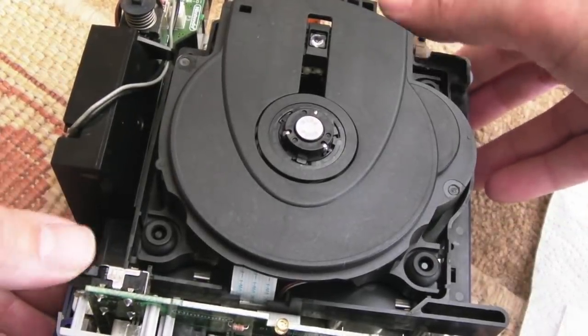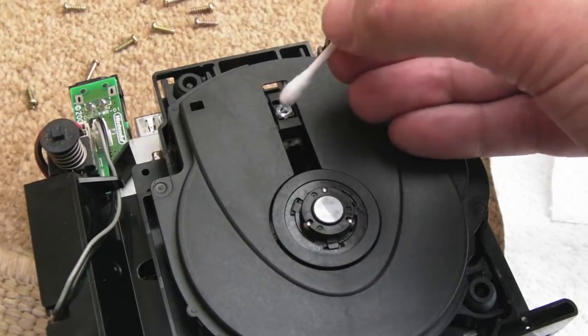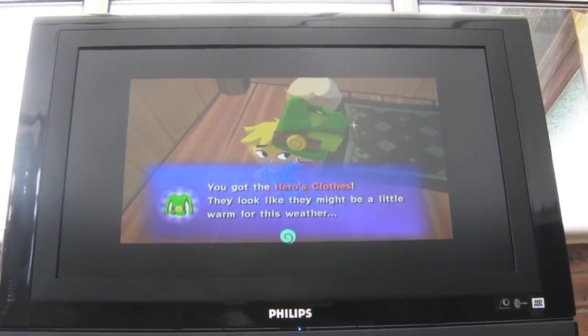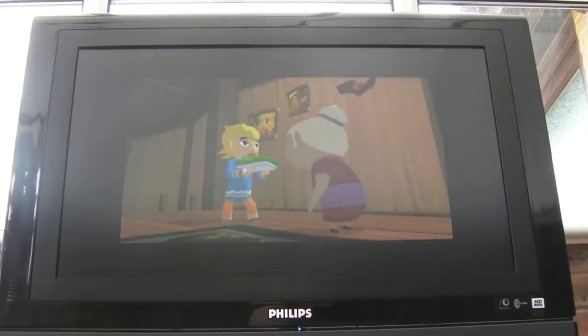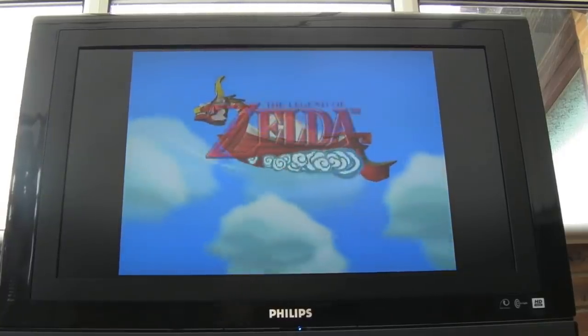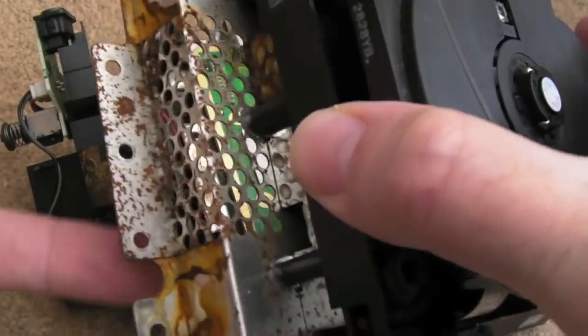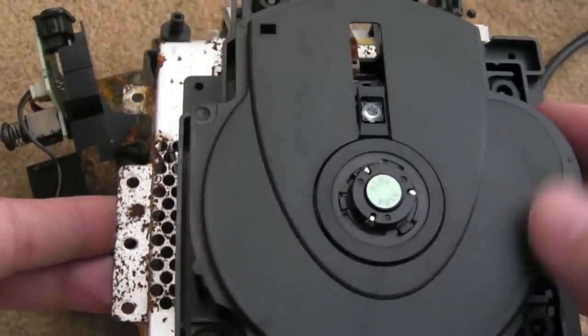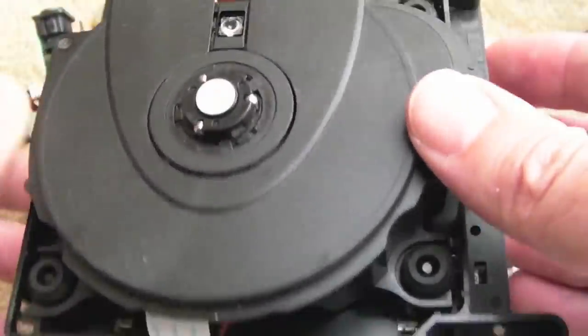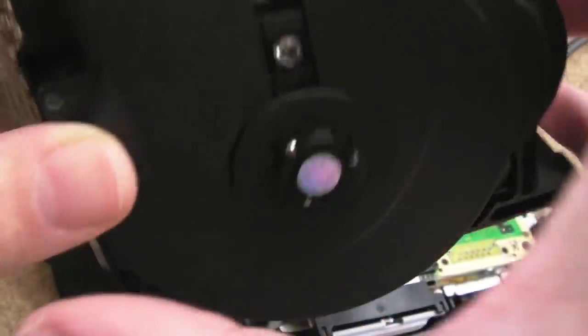So we'll get the lid back on, clean the laser lens very gently. The game that came with the black one — Wind Waker — it works. I did take it to Game to get it resurfaced. This system is working fine. Things haven't worked out too bad. You can see how rusty the one from the black unit was — far worse than the other one. It's interesting that they both had corrosion. I suspect because these are not valued very highly, they just get stored in garages and attics in really damp locations. We will revisit this drive in a later video because I think it just needs a new laser — I've got some new lasers, just haven't got around to testing them yet.